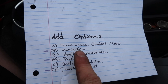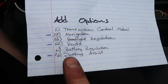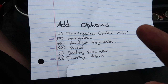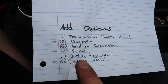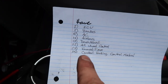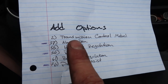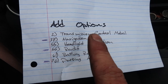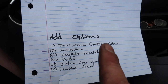Like this one doesn't have navigation so it didn't pop up. This is what popped up on the code reader. Now these are the additional ones that I noticed when I was going through the scanner trying to connect with those modules. So that means these are options but not necessarily in the car. Now I'm trying to find out which one is grounding — so these ones are all good, I don't need to check any of these. I just need to check these ones to see which one's going to ground. The transmission control module might be one that we have.